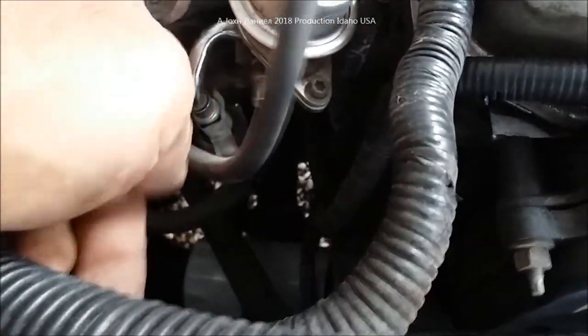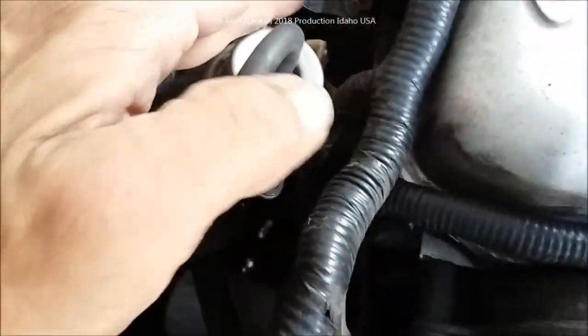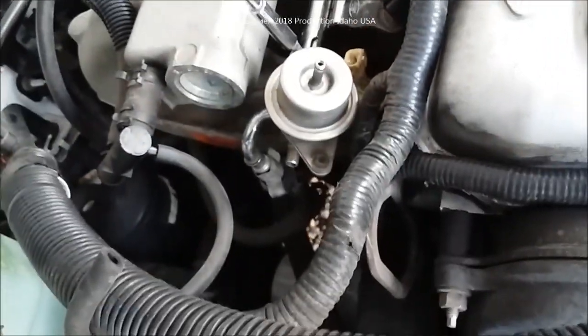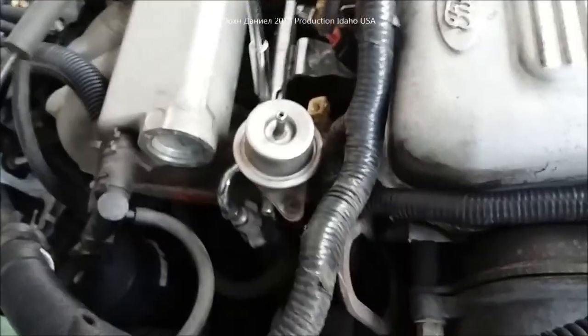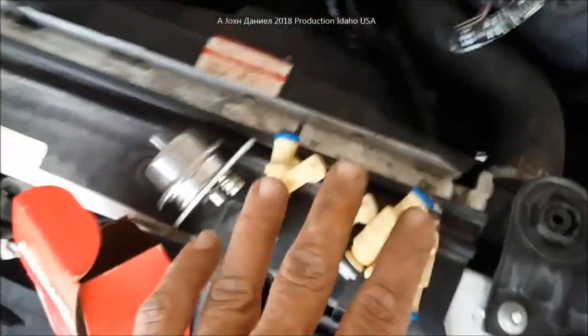Your fuel return and fuel incoming lines over here are rubber, so you've got movement and you don't need to move it very far. What makes this job a little easier is to go ahead and get the regulator off — it's just a set of T25 Torx bolts. I've got a new one for it; I always recommend if you're going to change out your injectors, change the regulator too.